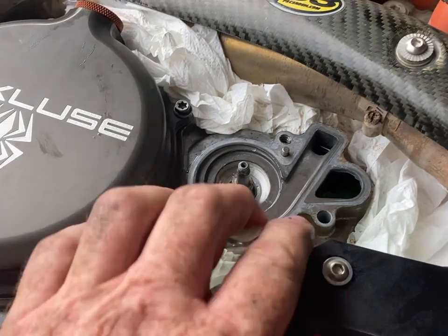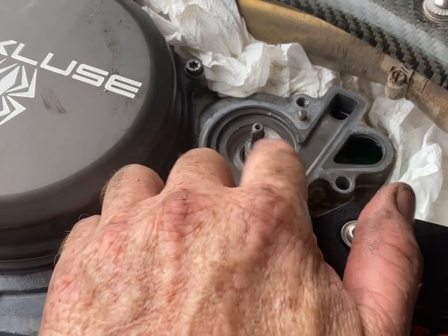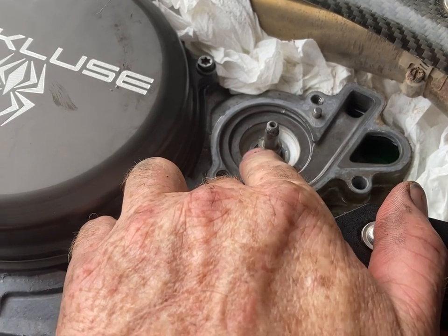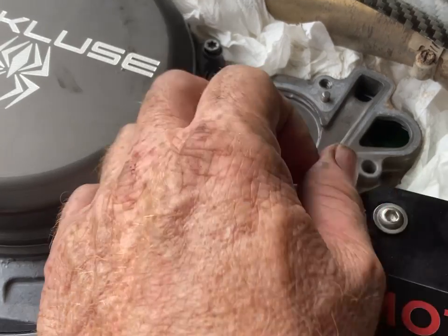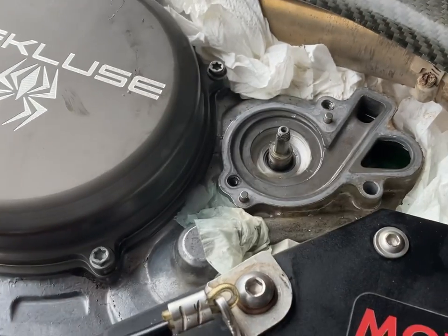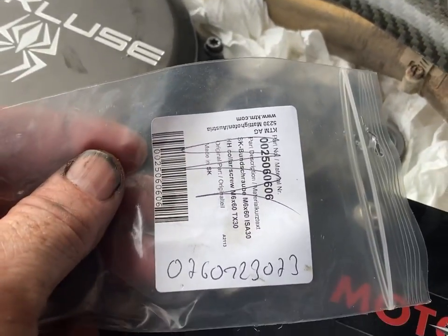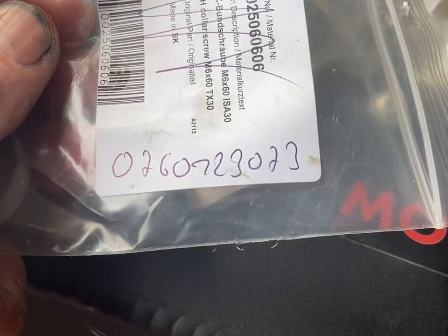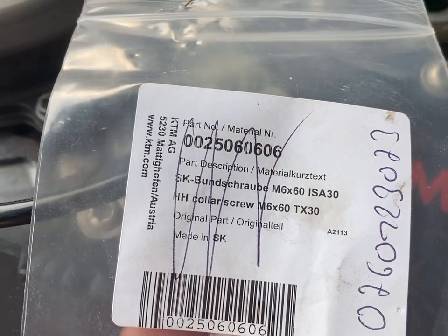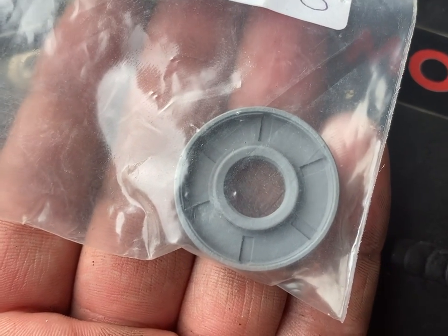The reason for that is you don't want your coolant seeping in as the impeller is spinning — this wears the seal and it seeps into the engine and goes into your engine oil. So it's oil on the backside, coolant on the front side. I'm not sure if that part number is correct since it's scribbled out, but just double check on your model and that's what you need.